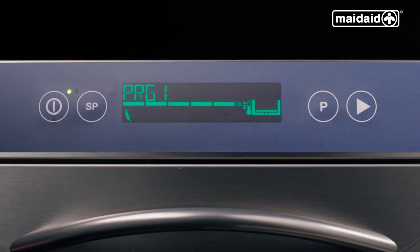Going through the standard programs: PRG1 is a very short cycle designed for lightly soiled or lightly dusted glassware. PRG2 is your standard general cycle used most of the time, perfect for lightly soiled glassware that has just been used. PRG3 is a slightly longer cycle than PRG2 to allow products left out for a while to soak. We also have a cleaning cycle, highly recommended at end of day to drain the machine down, running for approximately 10 minutes. Finally, a drain program is a partial self-clean and quick drain cycle that can be used mid-service to change the water in the wash tank.